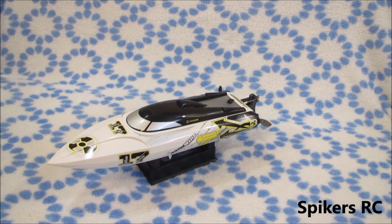But please verify they work, because I found ones that should be identical to the ones on there. They didn't work. All I got was a whole bunch of cavitation behind the boat and very little speed. I went back to the stock prop, worked just like that.